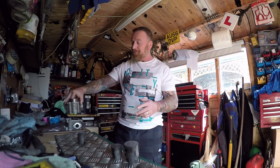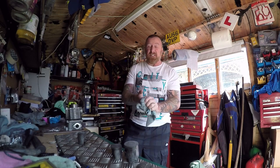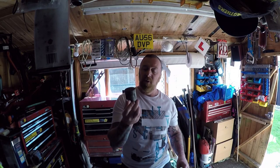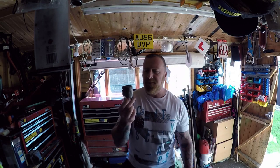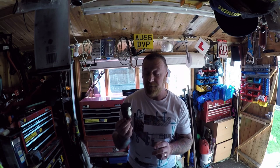Now I know the different kits you can get - 70cc, 80cc, 120cc and so on. But it's the same thing I'm saying: don't do it. It's my personal view. I generally find that if this is a 50cc and this is a 70cc, they're not made to the same OEM standard. They're cheaper, unless you get really expensive ones, and they fail. So you're on there getting a bit more speed out of it, and it will fail very shortly after. Also, you can't just slap a new piston - say a 70cc or 80cc piston - on a 50cc bike and expect it to run.